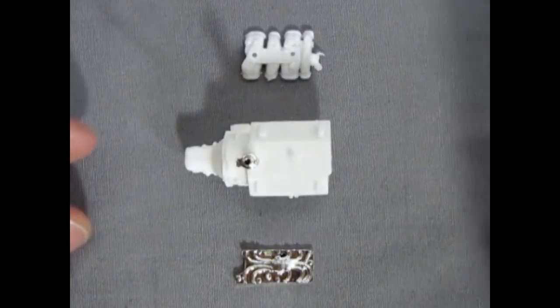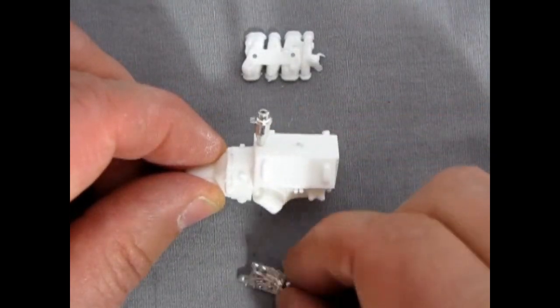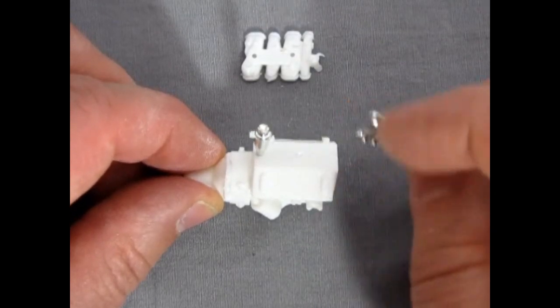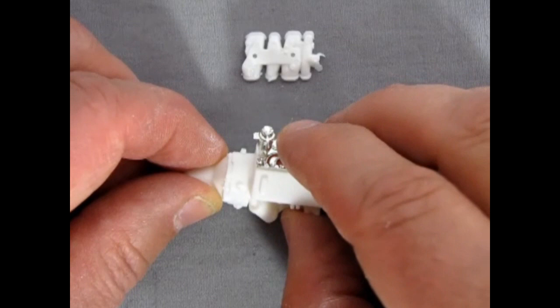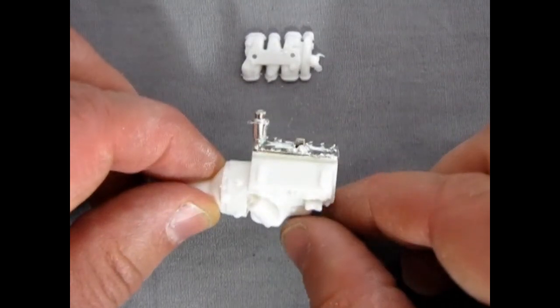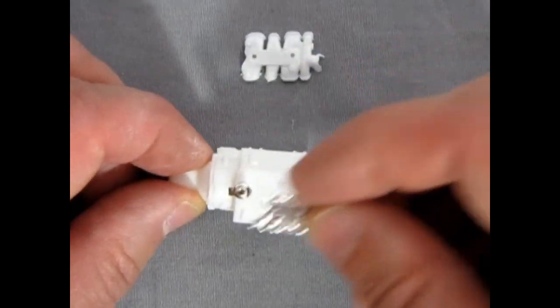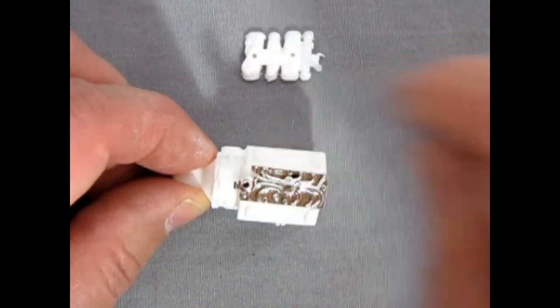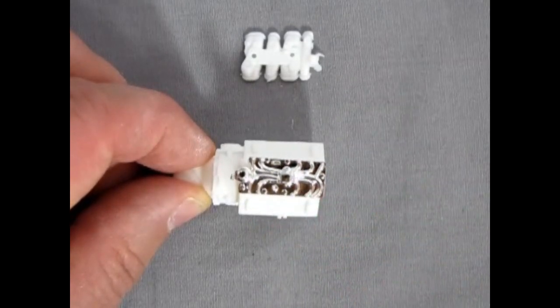There is another little issue I noticed with this kit. So what I did is I put the magneto into the little half hole in the back, and there is a pin that sits here. Now with our Hillborn fuel injection, it's not really much of a problem. The pin is sitting up quite high because this is like right off there. However, you can see that the manifold has a notch in it which clears the magneto, and that's all good.